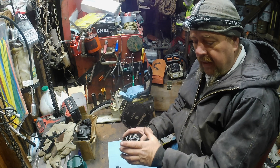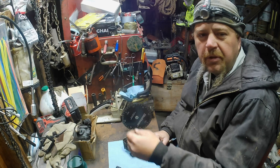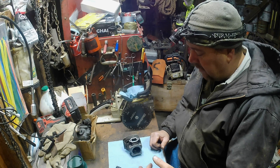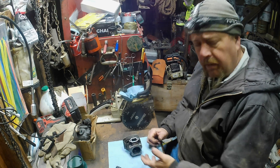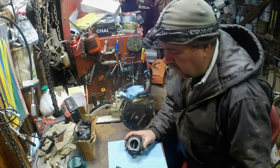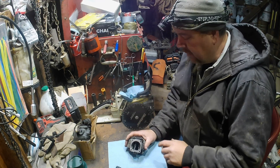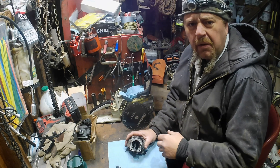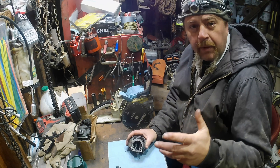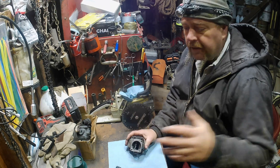On a four-stroke, if I need to raise my RPM I might know that for a certain RPM range on a circle track I may want 210 degrees duration and a certain amount of lift for a certain size engine. Same thing with chainsaws — you need to think of lift and duration together. Consider a drag car: you hear them coming up to the line, they won't even hardly idle, they're sitting there shaking, just can't hardly run — but boy when they get up to RPM, they smooth right out and run, because their lift and duration is tuned for that RPM range.